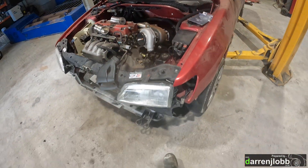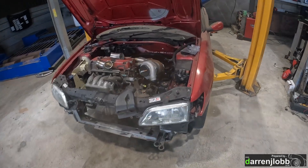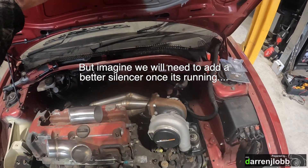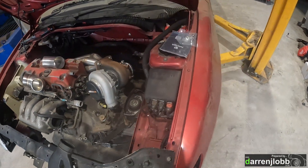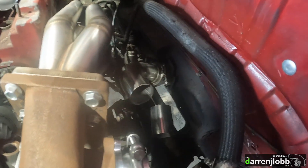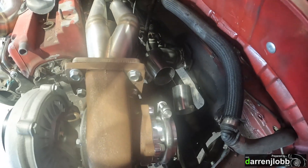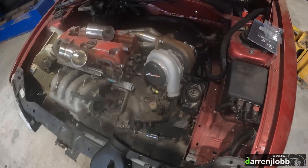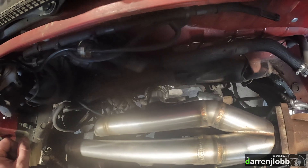We're going to actually reuse the exhaust that's already on the car because Sam had a fairly decent two-and-a-half inch exhaust system on the HDi. So it seems no sense replacing all that for the sake of it. We're going to join into it just underneath the gear stick where there's an existing V-band on the rest of the exhaust. What I've already done is underneath I've just tacked together a new pipe under the car to join into this downpipe here. We're kind of doing it in reverse, starting down there and coming up to meet up here, which in some ways makes it a little bit harder, but we need to make sure it lines up down there.